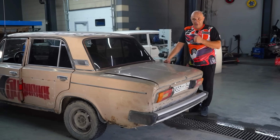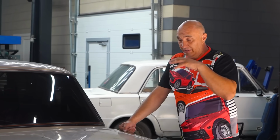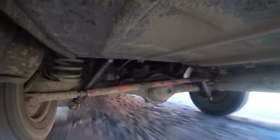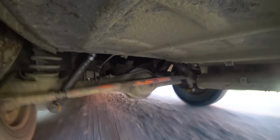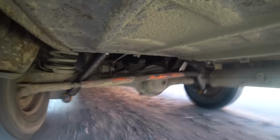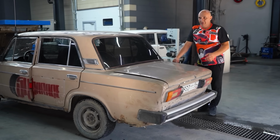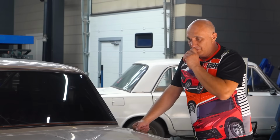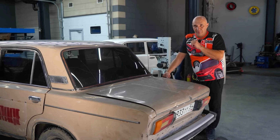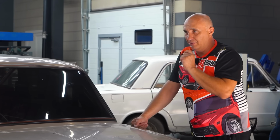That being said, when you're driving down the smoother patch of road and right after that, you wind up on the bumpy section, well, as soon as the suspension begins to articulate, and it doesn't matter which direction, things become a bit choppy. So the suspension is quite stiff, and it's the same story when you're rocking it. And so, we've got two holes in each piston. Why don't we go ahead and take the shocks apart and try making them a bit softer?